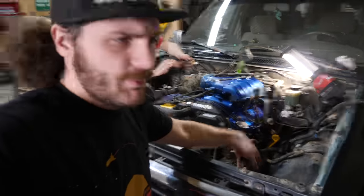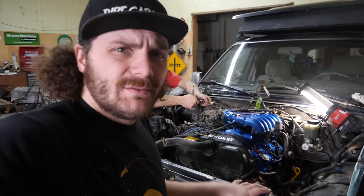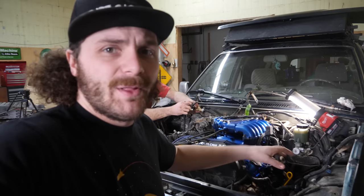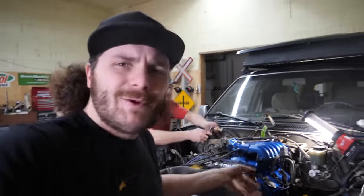The 3-liter alternator harness, which is this guy here, just plugged right into the 3.4. It was the same plug. I have a feeling because this is a '94, it's a later 3-liter, and this engine's a '96, maybe Toyota changed that plug or changed the alternator in later years, because I swear on my '89, I just switched that plug. So you might have to do it, you might not.